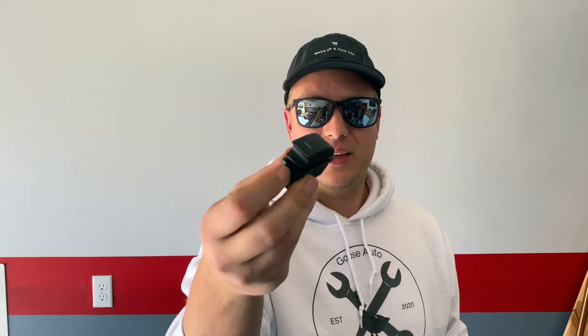So what I picked up are some of these little guys. And while it's not exactly OEM to what was in the Lightnings, it is strikingly similar to what I have in my Mustang and what is in my wife's Lincoln, which of course are both Ford products. So I feel like we'll have that kind of OEM look and feel to it — and just be a lot better than this right here. The good news is that both of these are five-post connections, so we can use all of the same wiring and same wiring instructions that come with the kit and we shouldn't have any issues.